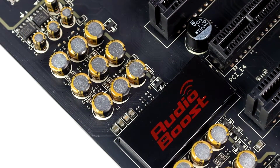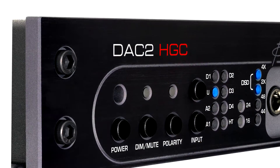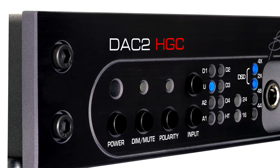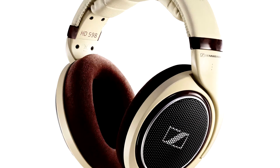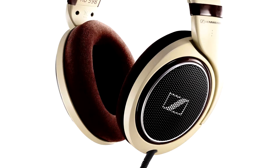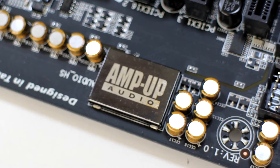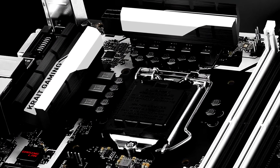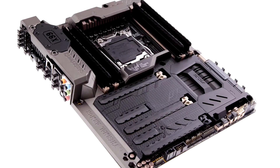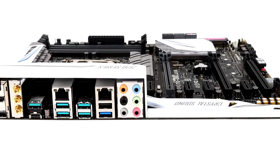Finally, some miscellaneous features: onboard audio quality varies between motherboards. If you're using high-quality headphones like Sennheiser HD598s, consider a board with a better audio chipset. The top current option is the Realtek ALC 1150; the step down is the ALC 892 — I wouldn't recommend anything worse than the 892 if audio quality matters to you. Other miscellaneous details include the board's color, style, and whether it has heat spreaders or PCB shielding. Higher-end boards will have all of these, along with extras like six USB 3.1 rear ports, though that's arguably overkill.